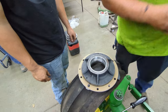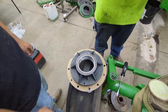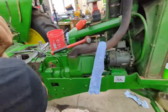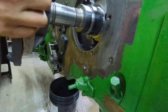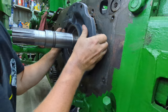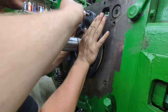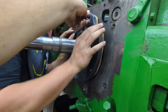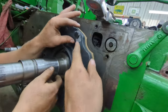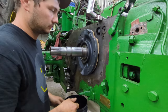Get that rubber put in there, grease the bearing, find all our bolts, and get it put in. We've got to make sure that we get that oil passage lined up. Gently. Got the new tabs to lock them in place. The rubber stayed in — that's why you put the grease on it, keeps it tacky. We'll get some more bolts and finish putting this in.